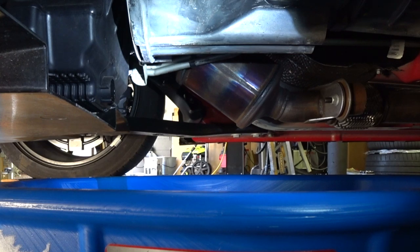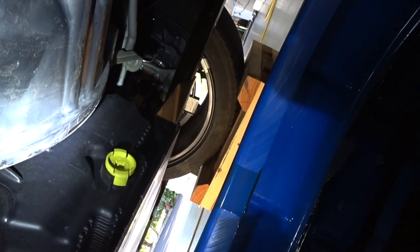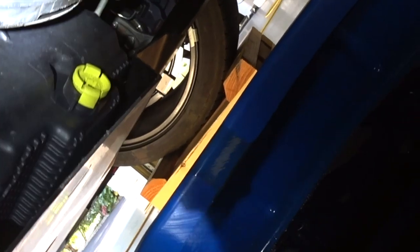We've elapsed the drain procedure. Just going to give it a wipe and put the drain plug in by hand. You don't have to torque this one down — it just goes in and locks into place. It has a little indent, bottoms out when fully tight, and has a spring-loaded mechanism with an O-ring so it's not going to leak.